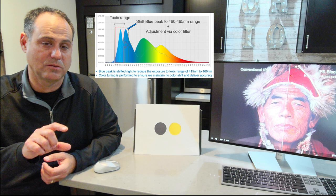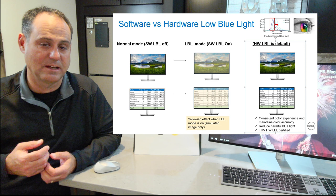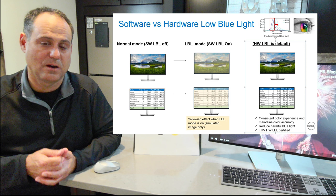There's effort to eliminate blue light. If you eliminate it 100%, you've gotten rid of your blue colors and the screen looks horrible. A hardware-based low blue light solution takes the spectrum of blue that is right next to the unseeable UV blue and eliminates just those — the ones that don't address your colors — while keeping the other blues. So the screen doesn't damage your eyes and you can work all day without irritation. That is what we call Dell ComfortView Plus hardware-based low blue light.